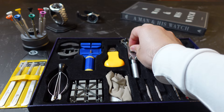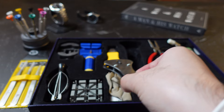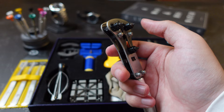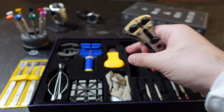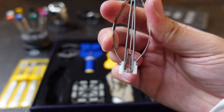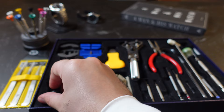This is called a three-prong watch wrench. You place it on the back of the watch and twist it clockwise or counterclockwise to open the case back. However, not all watches have the necessary pins to apply the wrench tips. Some will just require the case opener instead. There is also a hand remover tool — you place it on the watch with a plastic sheet that you're supposed to use but is not included — to remove the hands if you want to replace or swap them.